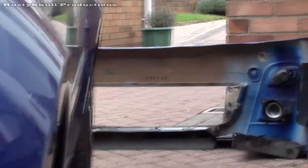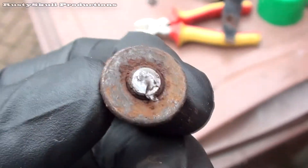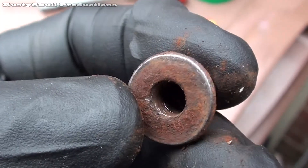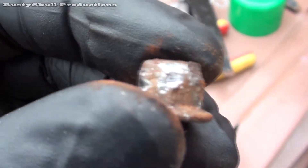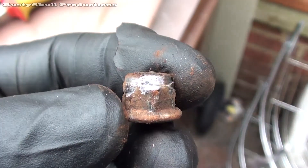Well, here we are — there's the bumper, it was fairly stuck. That penetrating fluid didn't really work, because that's the state of one of the nuts — snapped off. So I'm just going to make do without that; there's another two holding that side on anyway. The second one on the other side was very, very stubborn — I couldn't get at it with my ratchet very well, I could only get not even a click on the ratchet. So I ended up using a little bit of brute force, managed to get it in there, and in the end managed to get it off without it snapping.